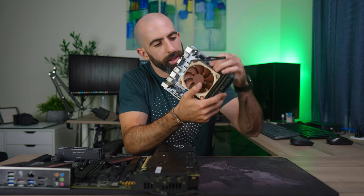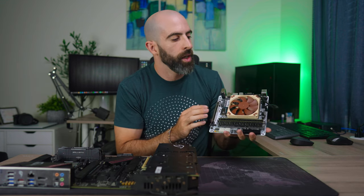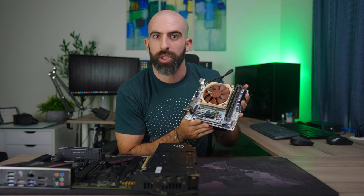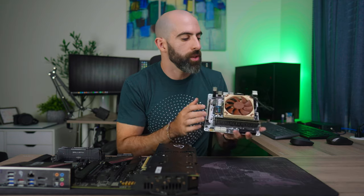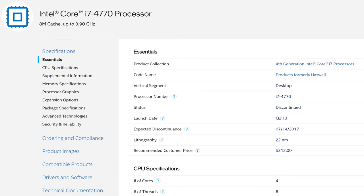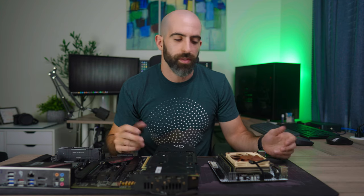For our Hackintosh build, we have this tiny little guy — reused from my last video where I built a tiny desktop home server. We're using an Intel i7-4770, that's four cores, eight threads, and 16 gigabytes of DDR3 1600 megatransfers RAM. We also have a 256 gigabyte NVMe drive. Nothing too powerful, since I don't plan to do much with the secondary system.